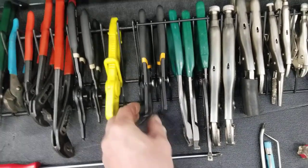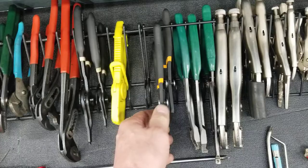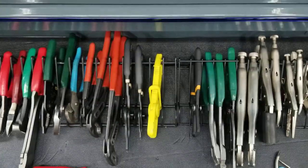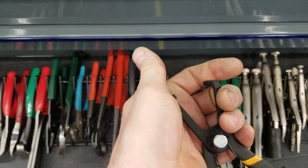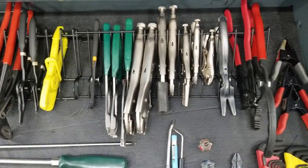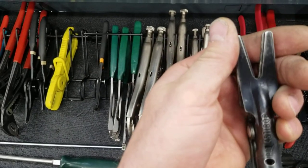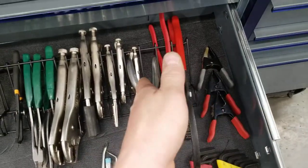On this plier rack — I've got two separate ones — it ends here and begins there. They're designed so the first five spots where that bar is hold spring-loaded stuff. Then these guys get in and grab those little plastic panel clips — and whoever invented plastic panel clips should be shot. Then we've got some more snap ring pliers, and these are for taking off fuel lines and vacuum lines — tube side on one end with a little knife blade, hose side on the other, and you just work them off. Some oil filter pliers, and a CV axle tool.